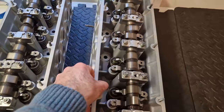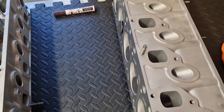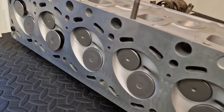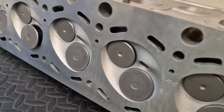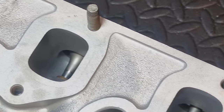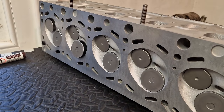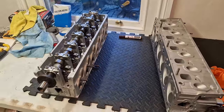So let me just flip one of these over and we'll take a look at the valves. And as you can see, top class job. So these are the original valves, all fully refurbished and in top condition. The heads have been skimmed as well. I think they were skimmed to 0.1 of a millimeter, so the allowable on the M70 heads is a maximum of 0.2. So they look really, really good as well. So I cannot wait to get these installed, and we'll do so in the next video.